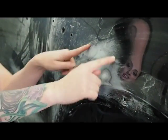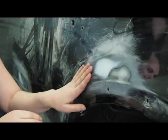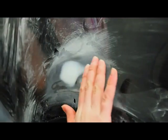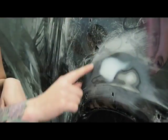So what we'll do is sand this area, put our polyester putty, and sand the putty. If you check it with your hand, it's smooth. You shouldn't be able to feel any transition. That's incredible. Then next we're going to put a primer over top of that.